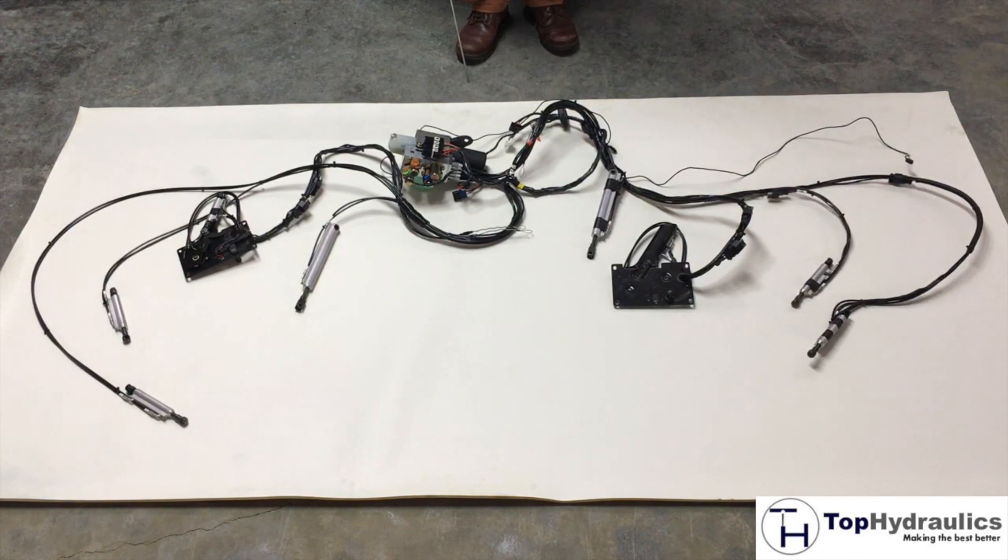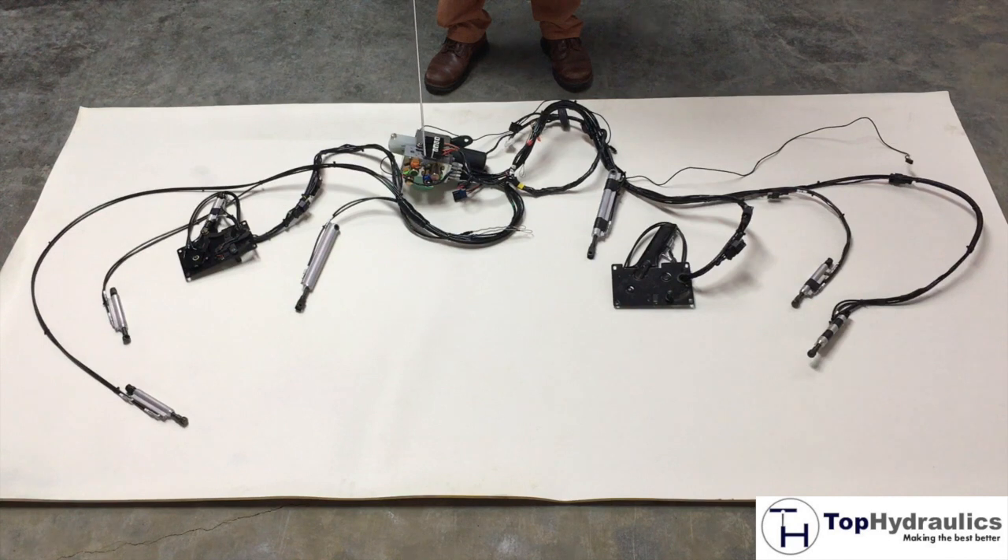Now what can go wrong on this system, you might ask yourself. The SSR is an awesome car and it should have a hydraulic system you don't have to worry about. All OEM hydraulic systems have their weak spots. The pump can leak. The pump can have malfunctioning valves outside or inside, failing seals inside, wearing pistons, and a wearing electric motor. The pump pushes hydraulic fluid to the individual cylinders, and movement is directed by the solenoids on the outside of the pump depending on the direction that the electric motor turns.